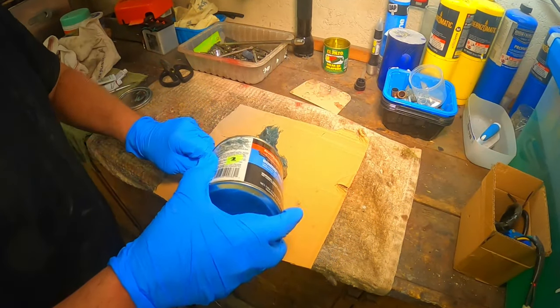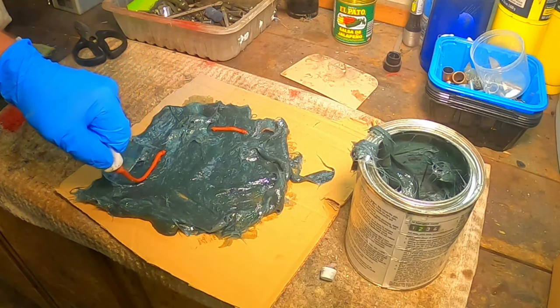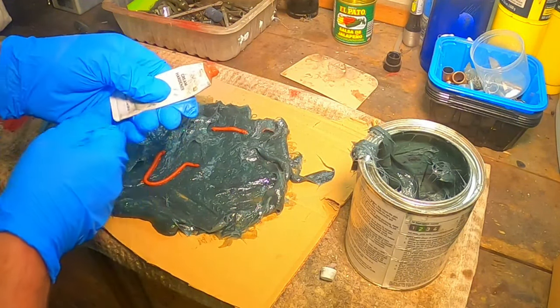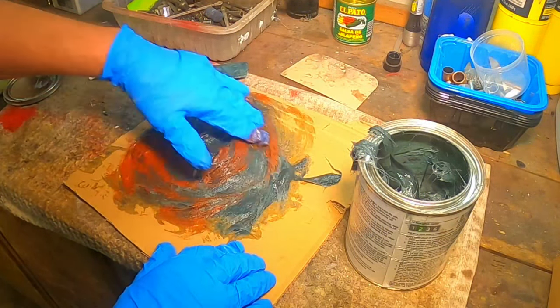The rectangular shape didn't turn out completely perfect, but that's nothing I can't fix with a little bit of long strand fiberglass filler. I'll just mix up and lay down the filler on the imperfections, and then I'll block sand everything back to the rectangular shape I'm looking for.